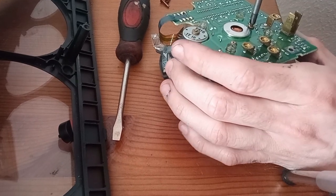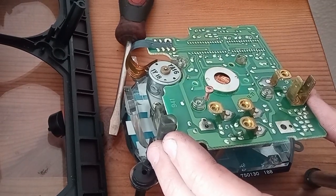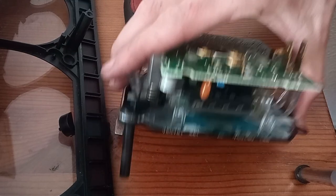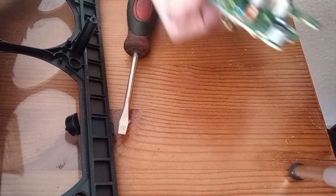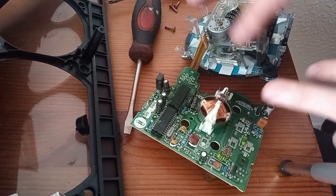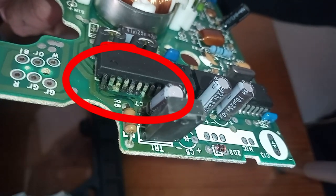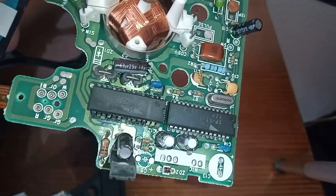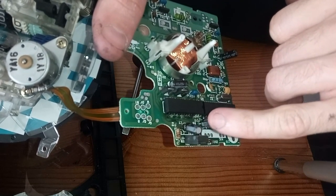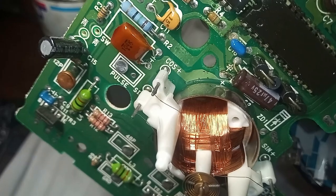So this is the old one - we've got these four little screws here. I've already taken the needle off - literally with a flat head screwdriver, opposite sides, then just pop it off. We need to be really careful because this is all really delicate, with really fine wires and things like that. It's pretty corroded, isn't it? These leak, and I think the other one is worse - there's been more leakage back here and over in this part. There's a gap there - that's not actually attached anymore, so that capacitor isn't connected.